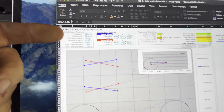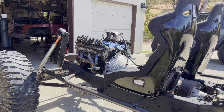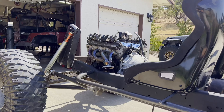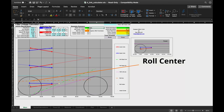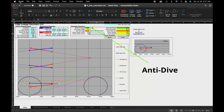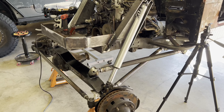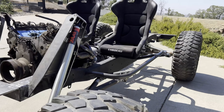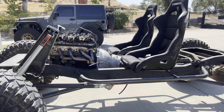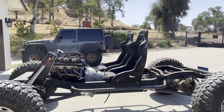Let's go over the three most important factors to consider when you're designing a four-link suspension. I've got a link to this four-link calculator down in the description, so let's open it up. When you're designing the suspension for a rock crawler, the three most important values are: first, your center of gravity — the lower you can bring it down, the more stable your crawler will be. Second is your roll center. And third, but still very important, is your anti-squat and anti-dive numbers. If you can understand and design with these three in mind, you'll be very impressed with the performance of your Jeep.